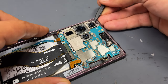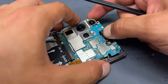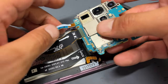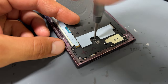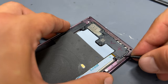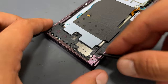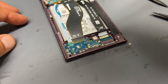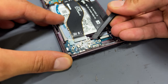We can now remove the logic board from the chassis and the easiest place to get this is with a spudger at the top of the cameras. Carefully pry underneath there to lift the board and release it from the chassis. I'll just leave that resting in there whilst we remove the subboard. To remove the subboard, unscrew the six crosshead screws that are securing down the loudspeaker and plastic shield and keep those safe for reinstallation later. There's a small arrow pointing into a gap that will allow you to pry up on the shield and release it. Repeat the same on the opposite side to release that plastic shield. There are three more crosshead screws securing down the subboard — get those out of the way and then using the plastic spudger lift the subboard out of the chassis.